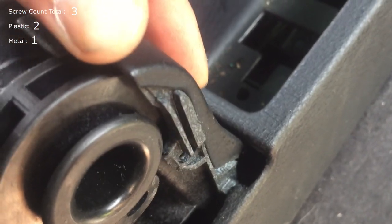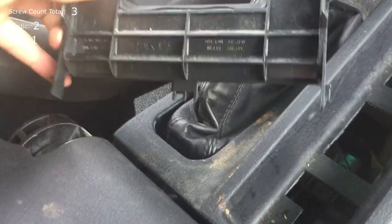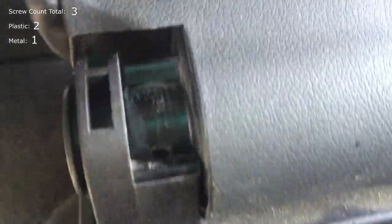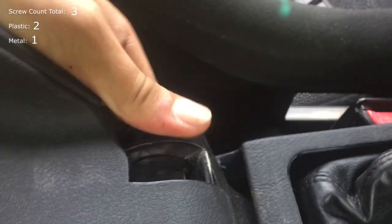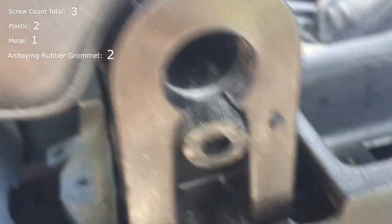Then you can flip this forward and you'll notice this will be attached like this — this flap will be on this pin. You'll put a flathead screwdriver in there and expand that on both sides, and this comes off, which gives you access to that hole. Take a really small flathead screwdriver, stick it in there, and push really hard. That releases this side pin. Pull that pin out and hopefully on the other side it just comes out too, but you'll probably have to use a screwdriver. There's a rubber grommet that sits right there — you don't want to lose those or you'll be extremely sad.